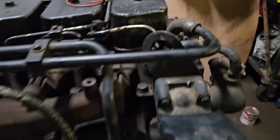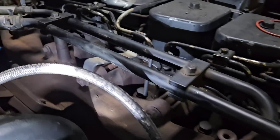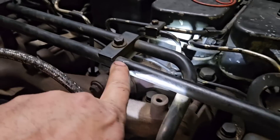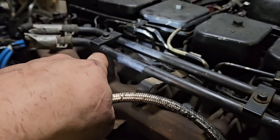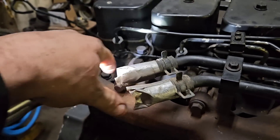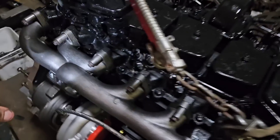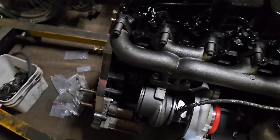This one is still set up factory. As you can see, it's still got the lines going over top. But these lines going over top make it harder to work on, and they always rot and crack and split right where the clamps hold them. In a Dodge, the firewall would be right here with your little short lines. But on the Ford, the lines aren't right here — they're over here, kind of thing.